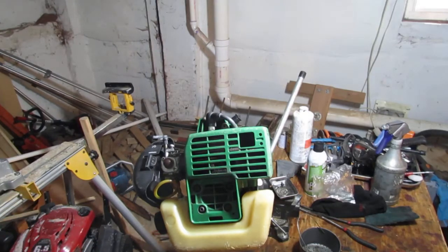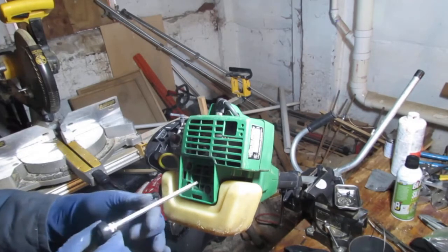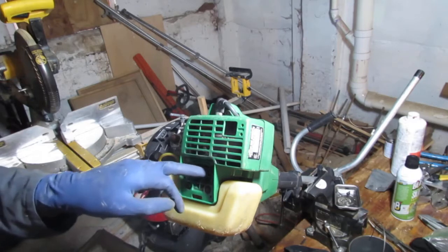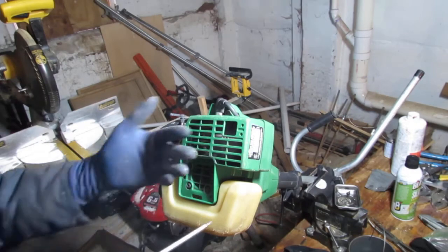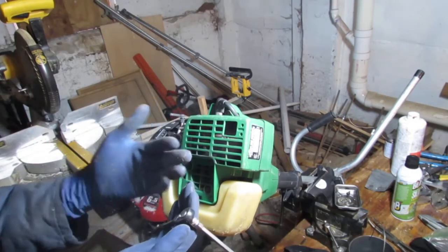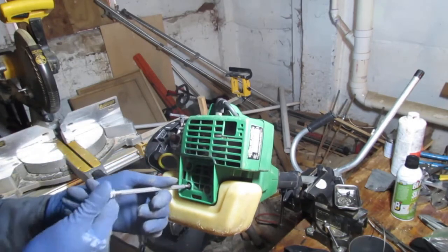What are you thinking? I'm thinking we should just go down the route of pulling this apart and see what's happening underneath there. Okay. Let's get this back shroud off. It kind of just protects the user from getting burnt. And it looks like this is the bottom part for the engine. The bottom part of this, the two-stroke short block, is covered back here with this, similar to the one that looks like this that we just worked on.